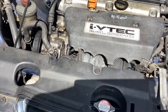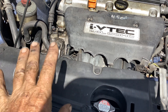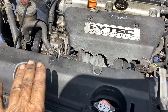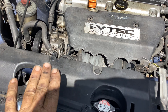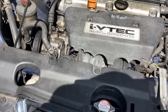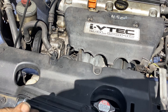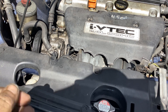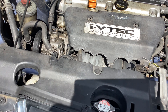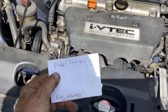Recently it's been running rough. I went out to breakfast with my son, uncle Brad, and my brother, and what this thing's been doing is starting up missing. I've been getting codes — multiple cylinder misfire and cylinder two and three misfire. I cleared all the codes and they came back, so I decided to look at each one individually. One of them was a P0661.